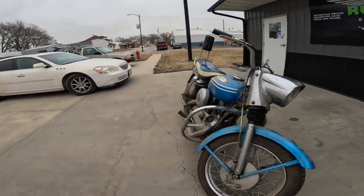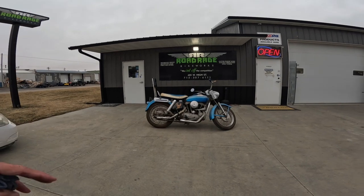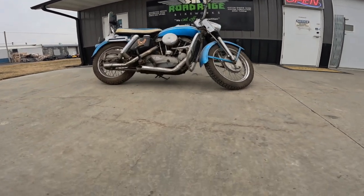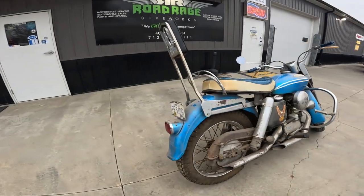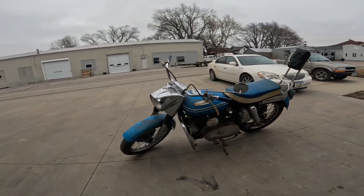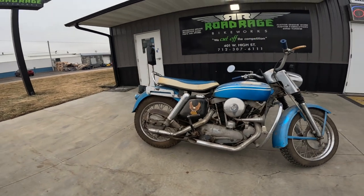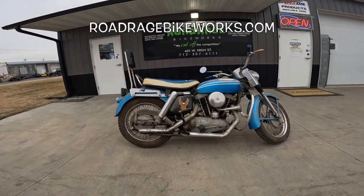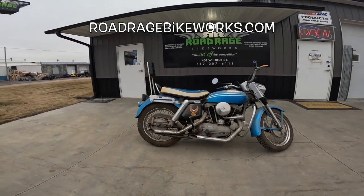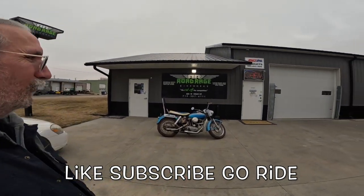Really quite a nice example of a 1962 Harley-Davidson Sportster — I'm absolutely impressed with it and cannot wait to see what Road Rage does with it. Some other details: it's supposed to have about a 57-inch wheelbase, about 6.7 inches of ground clearance, and weigh between 450 and 500 pounds. The seat height was about 30.5 inches with this seat. Horsepower is around 55 and 52 foot-pounds of torque, though accurate information is hard to find. Anyway, I'm just in love with it. Life is good — it's starting to snow here, but if the weather permits where you're at, get out there and ride, my friends. Wahoo!